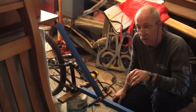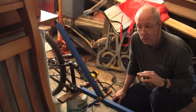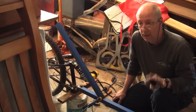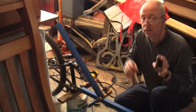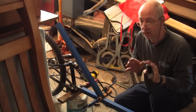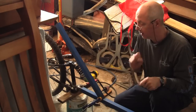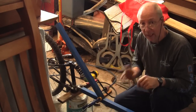Next will be to cut a couple of pieces of steel for the front wheels to go on. I am going to roughly assemble everything and tack weld everything. If it is not right I can just cut the weld, take it off, and rearrange it. For the moment I am just going to arrange everything and tack weld it on until I am happy with it, then I will go around and weld everything up 100%.